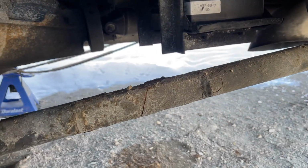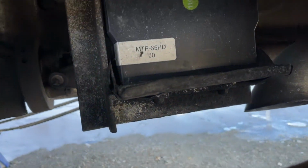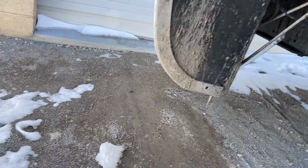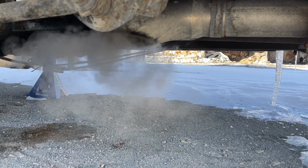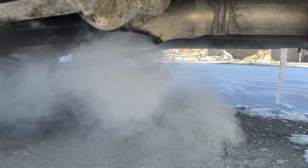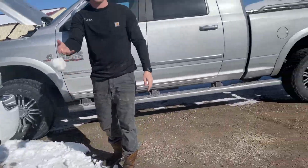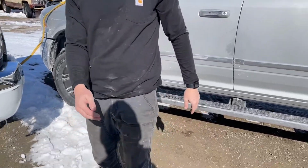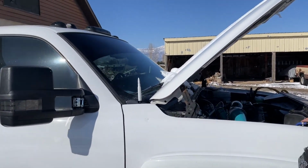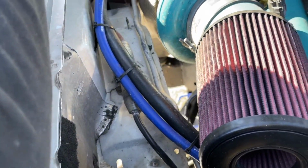The plan is to hopefully get some bags for it, change up the exhaust so that it comes out over here. Is that the other battery? Yeah. Figure out what's going on with that battery and whatnot. Clean up what we can, but take three. Yeah, she's gonna fire this time. Give her a shot of ether. She'll fire. She's close, she just hasn't been started in a week and it's been negative temperatures.